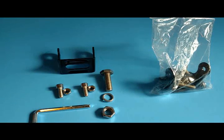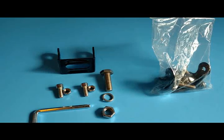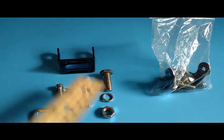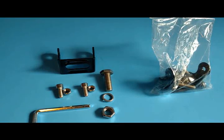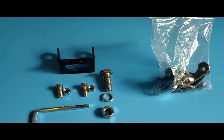This Northpole 18-watt waterproof spotlight LED bar light, it's pretty good. It seems pretty rugged. The aluminum housing seems really durable. The hardware, once you get all the right bolts and stuff, easily connects to the housing unit, so you can connect it to your vehicle. Again, you need to hardwire it to a power source. You're going to need to buy some type of wiring harness that'll have wires that connect to your power source and to a switch and then to the lighting unit itself. So that's the only thing I find lacking in this thing. I think it should have maybe come with some wiring switch or power source connector or something, but it didn't. But if you're the least bit mechanical, you can easily get a wiring harness and hook it up yourself.